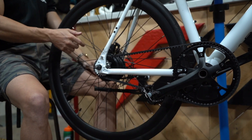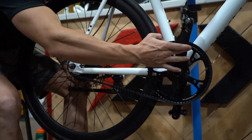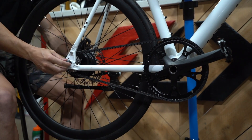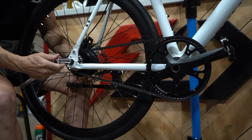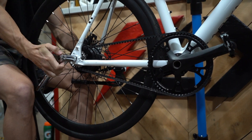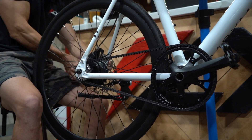The wheel is still lying properly. The belt is visibly looser and it is slightly easier to pedal. So let's lock that in for now. We're going to flip our socket the other direction and tighten these axle nuts. You want a decent amount of tension on them so they don't go loose, especially when you're climbing up a hill.